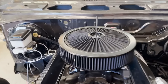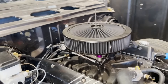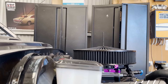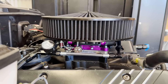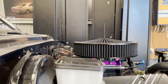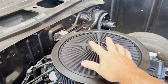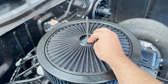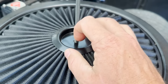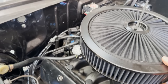So I've got the filter, which is a low-rise but it is still a three-inch rise, and that's going to lead to some clearance issues — as you can see that's not going to fit under the bonnet. I was told it was going to fit with that two-inch riser, but it just won't, so one of those one-inch risers is going to have to come out. One might squeeze it in. I also need to cut this bolt and get some low-rise washer screw tops off eBay to button that up. So that's nice and covered now, doing away with the glad wrap.